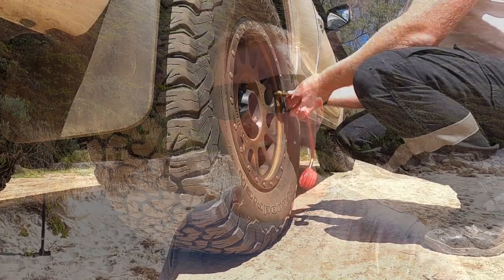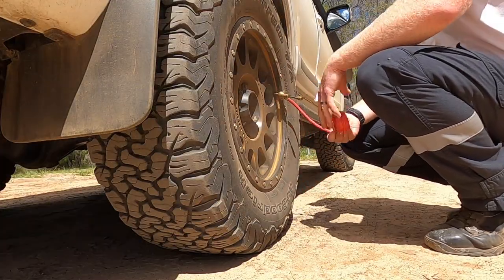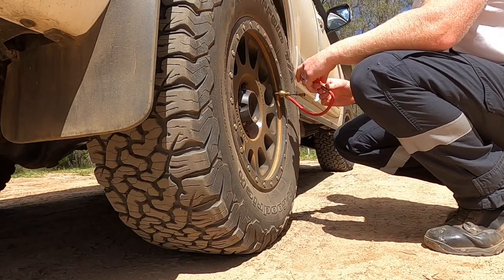That worst-case winch scenario is going to take a long time and a lot of effort. The other thing that helps big time is tire pressure. If you're stuck on a beach, you can lower tires right down in an emergency — even to around five PSI if you really have to — but adjust your driving style and be gentler so you don't roll a tire off the bead. On the car today we were running about 17 PSI on the front and 18–19 on the back, but we could have gone lower if we really needed to.